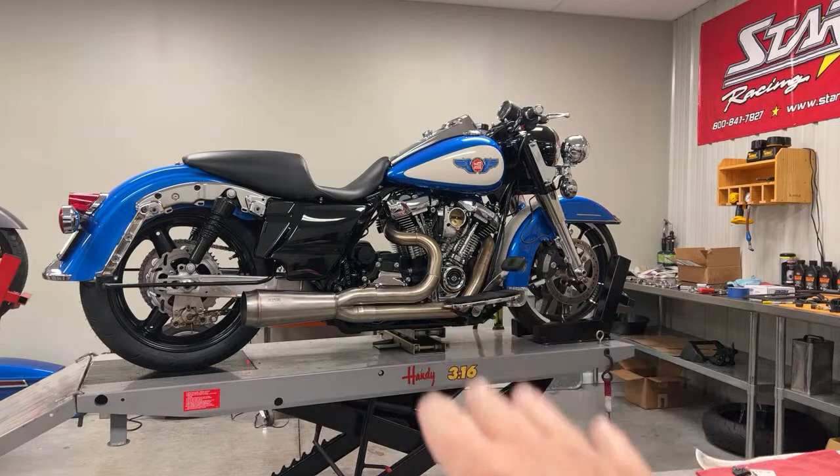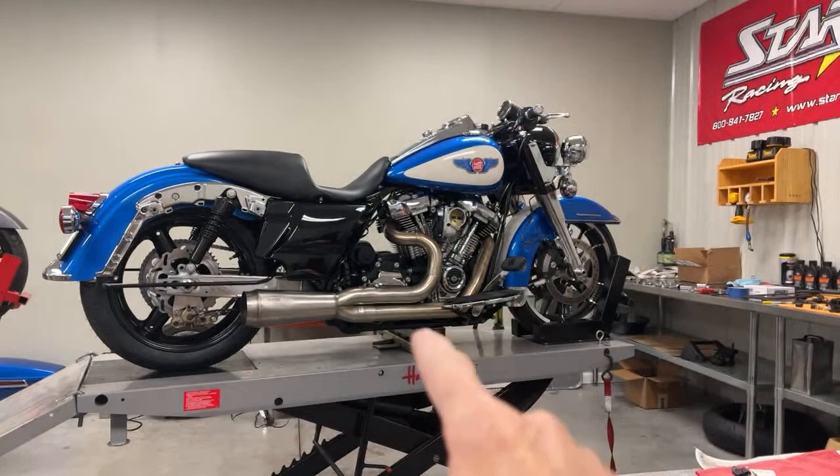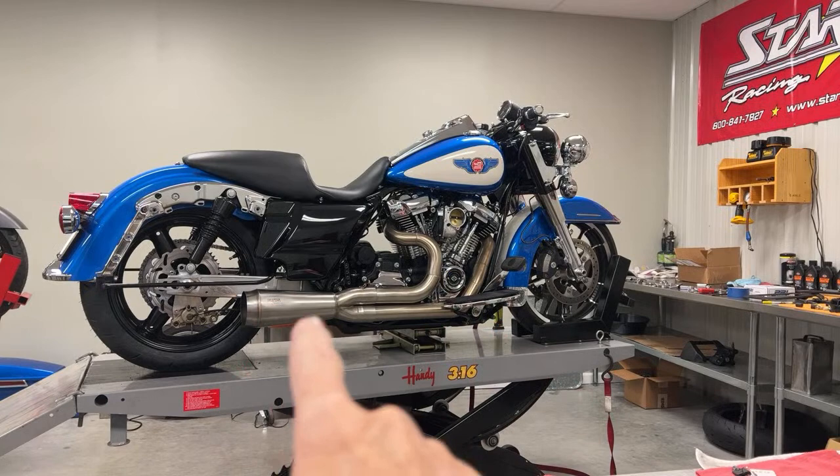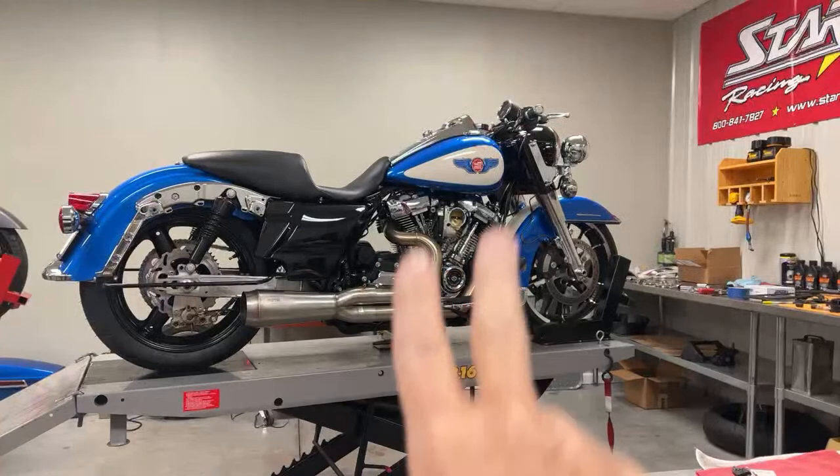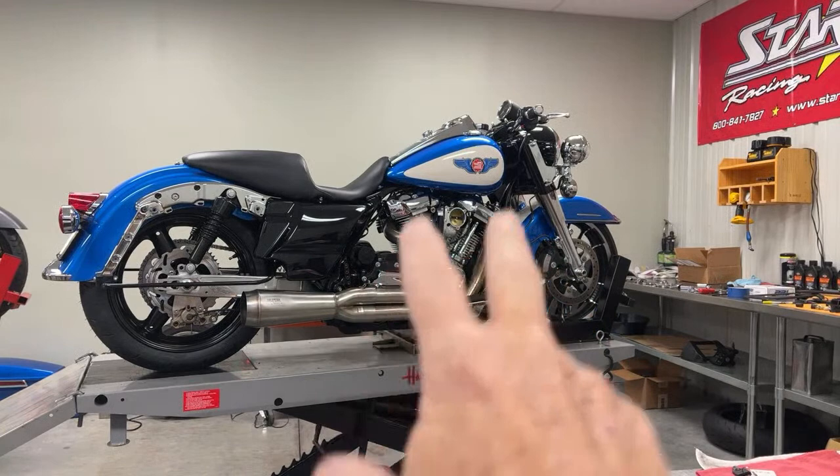This is not a wet sump engine. There's only supposed to be 2 or 3 ounces in here, and a ton of it is supposed to be 4 or 5 quarts back here in the tank. And the oil pump is supposed to supply all the bearings and all the rocker arms and springs and pistons, and the piston jets that cool the bottom of the pistons were supposed to be supplied with 40, 50 pounds of oil pressure. And then whatever runs off goes back in the sump and gets scavenged out of the sump